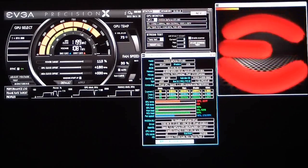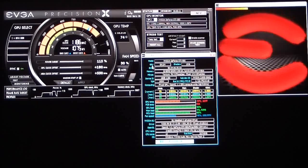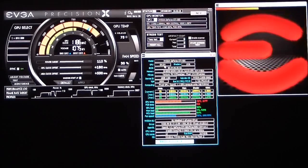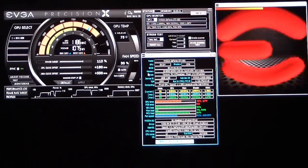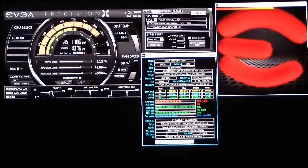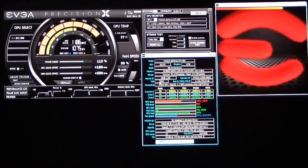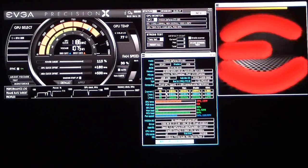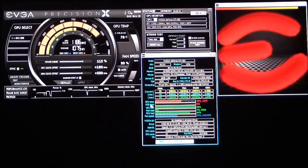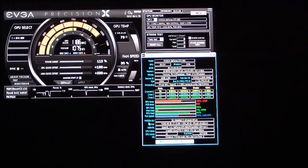Now let's go on to NVZ, which is kind of like CPU-Z but for the NVIDIA card. It tells you exactly what GPU you're using — this is the GK104, or Graphics Kepler 104. It tells you how many shaders, what type of memory, how many textures, your device ID, and the total TDP. This card's total TDP is 195; operating TDP while gaming is about 170. It also gives you line graphs or bar graphs of temperatures, PCB temp, GPU load, memory load, and fan speed.